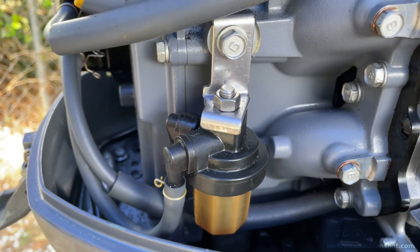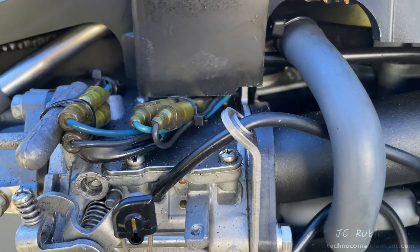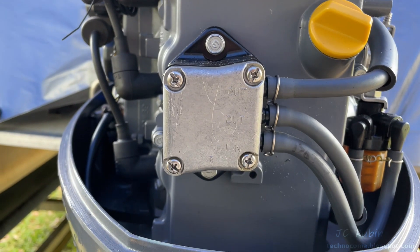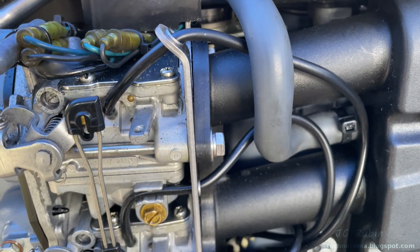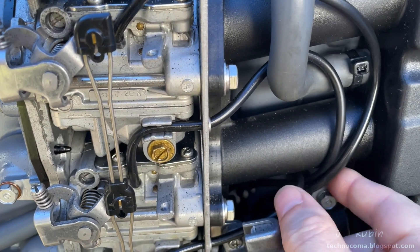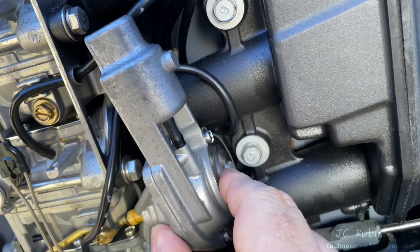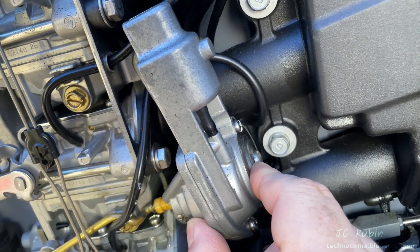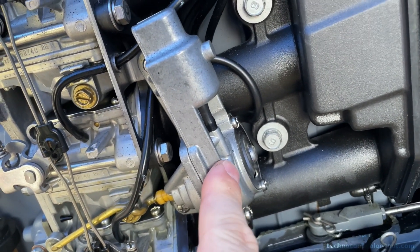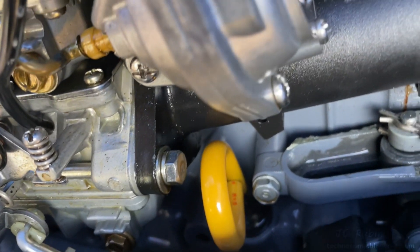While the gas filter will be serviced during this project, it will prove to be an obstruction and will be moved out of the way. There will also be electrical connections to disconnect. We'll have some fuel lines to disconnect going to the carburetors. These air bypass hoses could all stay in place so long as we don't have to separate the accelerator pump from the rest of these pieces. Some models — this engine may vary slightly by year — and the accelerator pump setup may inhibit the ability to remove this carburetor manifold setup, which would necessitate its removal. The oil dipstick will also obstruct and will be temporarily removed later.